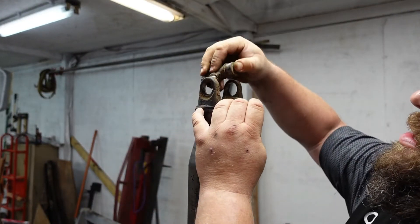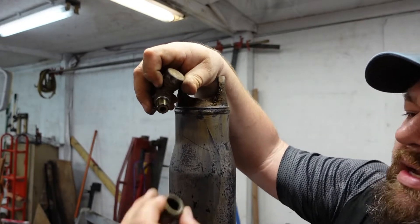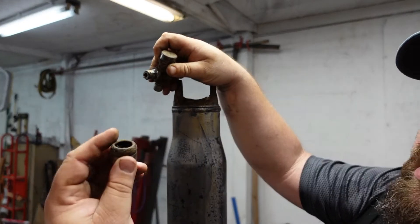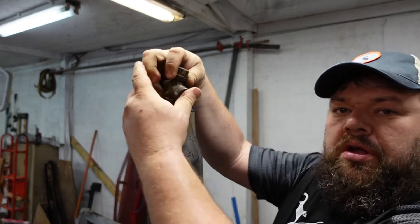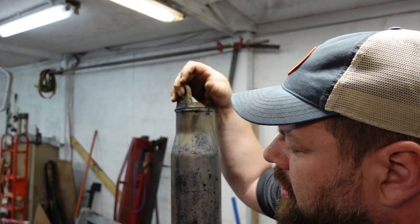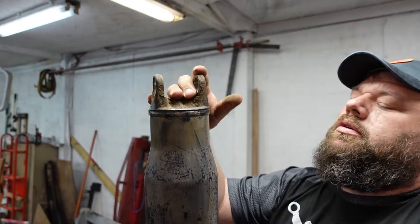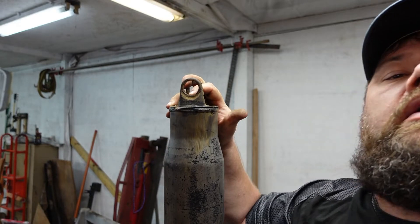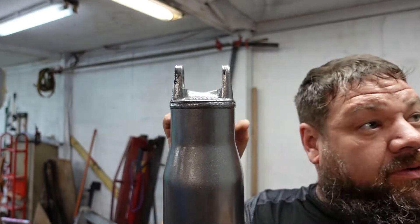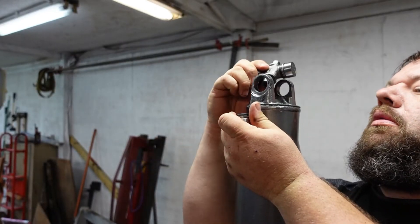That one actually had a little grease on it. Clean all this up real good because, again, what I've said is when you put these in you have to take these caps off. Those little specks of dirt right there are enough to ruin this U-joint — half the time that it should or more. So make sure everything's good and clean. I know I'll preach it enough, but that should be enough to eat off of right there. Let me get something and we'll clean this up real good. All cleaned up — that'll keep the contamination down to a minimum. Drop it in place.